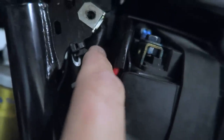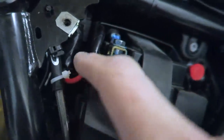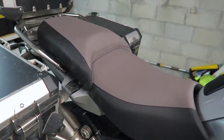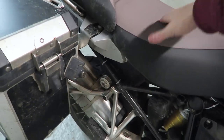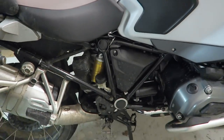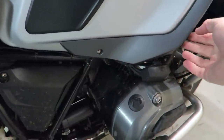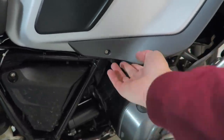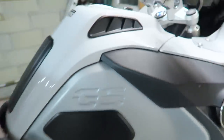I've put the ground plug there, and then fed the one with the live wire all the way down and underneath, zip-clipped everywhere I could. It's got the fuse in there covered in insulation tape as well. I've chosen to put it there because there's a cover that goes on the front, so I'm trying to give it as much protection as I can. The live cable goes straight back up onto the battery.